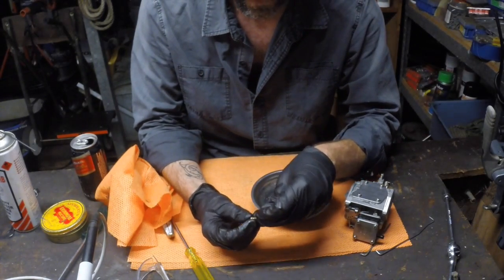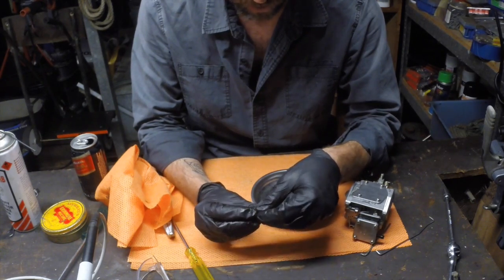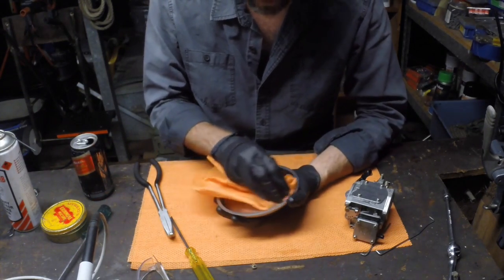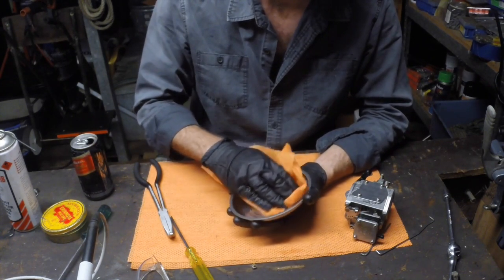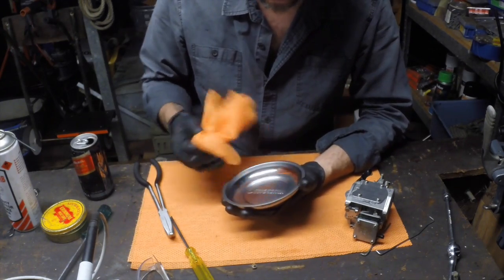So contamination can take quite a few forms, but water is definitely one of them. And it's amazing, because water doesn't dissolve in petrol, it's amazing how long a drop of water can live just sitting on a jet and blocking an outboard up. You think all that fuel running through would eventually clear it away, but quite often it doesn't.